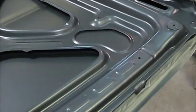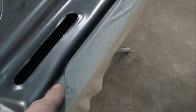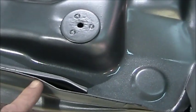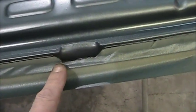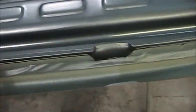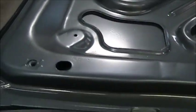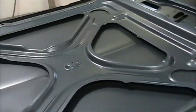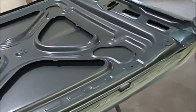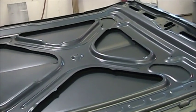On the other side, I taped this because this hood rolls around. So that's gotta be done too. And I taped this right here and cut it out for the inner frame, so I'm gonna have to retape this all back in again. And paper the underside of this so that it doesn't get all overspray on it tomorrow when I do the black and then the silver with the matte. So anyways, I'll be back here in a few minutes or half an hour or so.